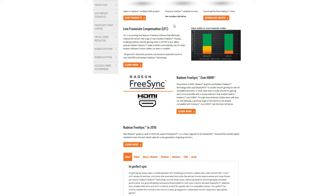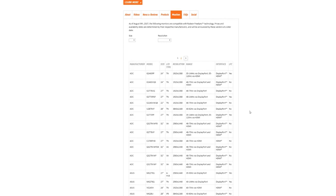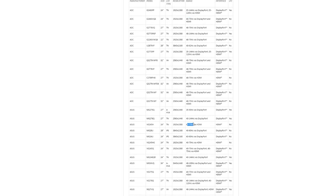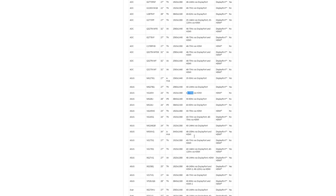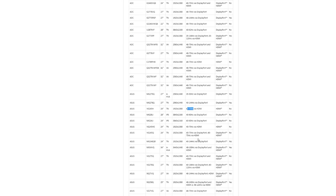That's really where something like LFC — Low Frame Rate Compensation — is noticed. If we check out the monitors here, you'll see a specific section showing whether or not LFC is supported by specific monitors, and this is part of the reason why FreeSync is kind of a weird solution. You can see ranges like 35 to 144 Hz, 48 to 75 Hz, 40 to 60, 40 to 75 — there's no set standard on where FreeSync goes. It's up to each individual monitor manufacturer to pick and choose what they choose to support.